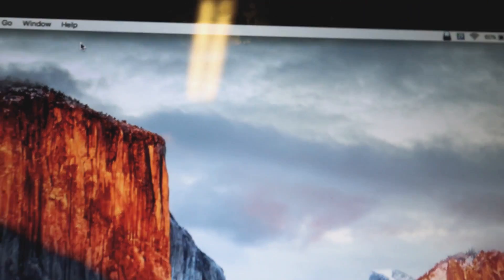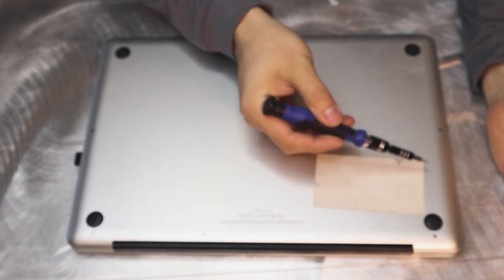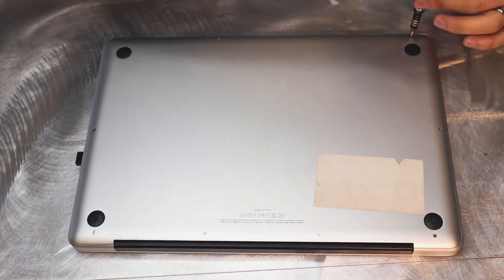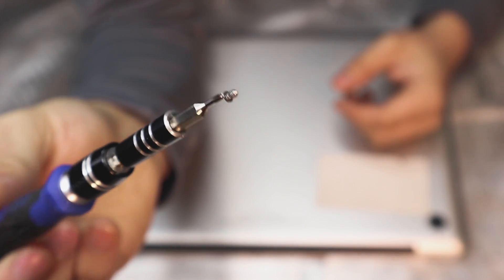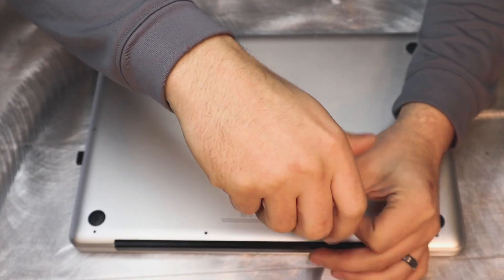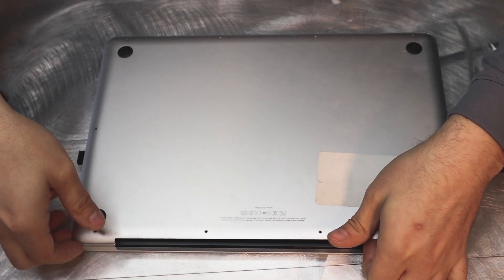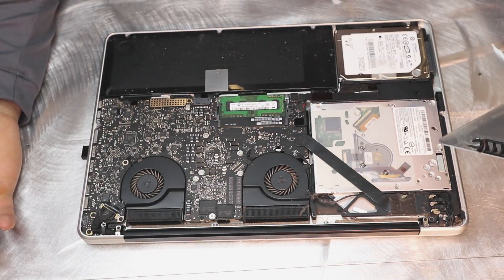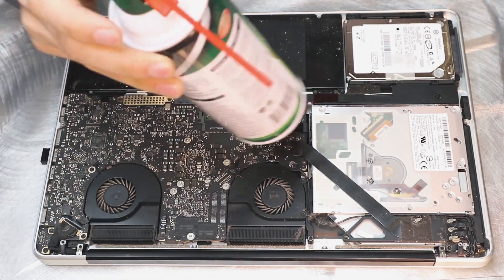Let's flip this over. First thing you want to do is power your Mac off and we'll get to work. You're just going to need a tiny little screwdriver, and you're simply going to go around and undo the screws on the outside. Make sure you keep them with the ports they go to. A magnetized screwdriver really helps because these screws are really, really small — you do not want to lose these. Once that's done, you simply lift the case off. And that is what the inside of your Mac will look like. Depending on how long it's been, there will be some dust buildup, so if you have compressed air, that is a game changer.